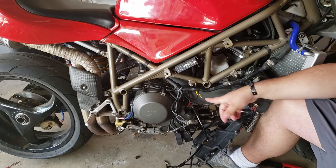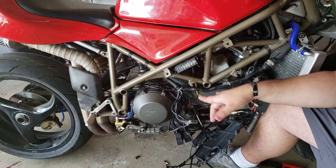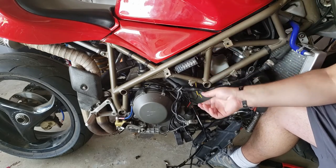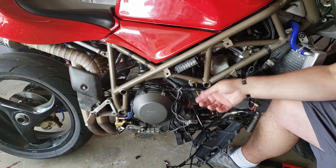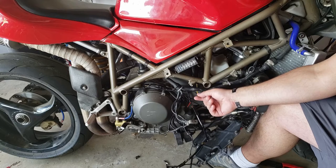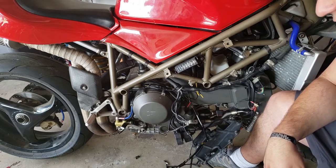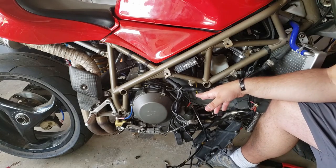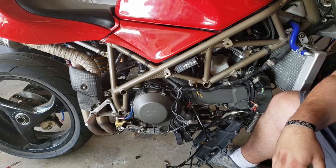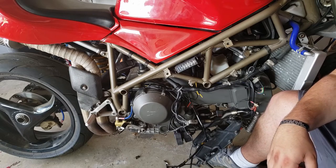Because I went back after that, I cut the yellow wires again, just like, am I taking crazy pills here? I tested again, AC current's coming out of both of these wires. I unwrapped them, I checked, there's no damage. These are not the stock wires. They're thick aftermarket things, which might be why the resistance is a tiny bit higher. But it doesn't matter. The voltage is putting out and the amperage out of here is sufficient. The regulator rectifier should be doing something. So I think we have a dead rectifier.